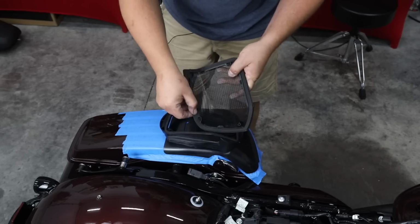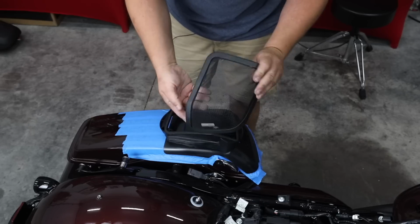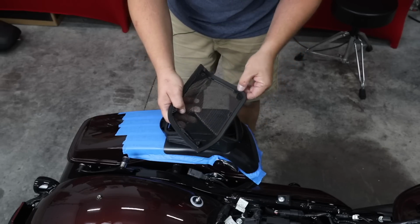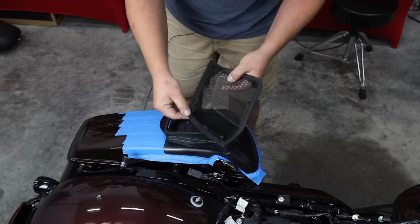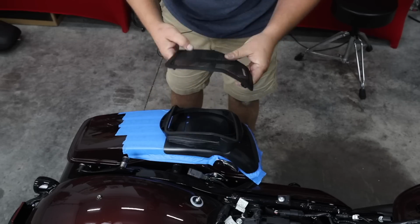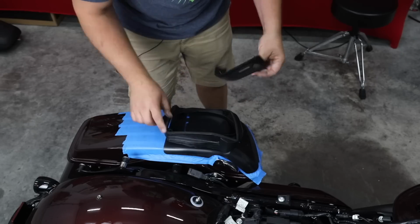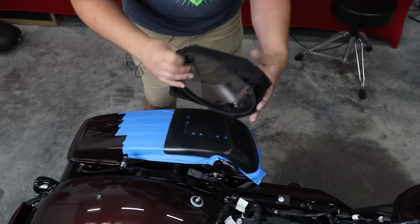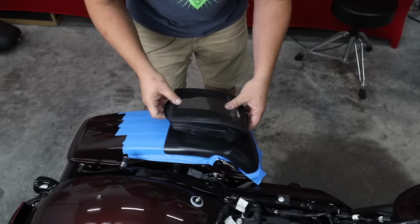If you'll notice, it actually has a much wider flange than most of the other kits. Now I think it looks really nice once it's installed, but this is important because we have a lot larger area gasketed to keep water from getting in our bag. It also gives us a stronger part because this is all that's really holding our speaker into the bag and keeping everything in place. The other side is also gasketed. And these two, once we've got it cut, are going to fit together, and 4 Phillips screws are going to hold this together and make a really tight bond.